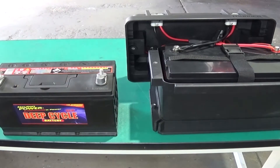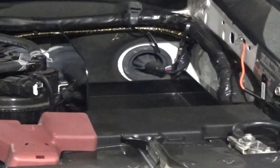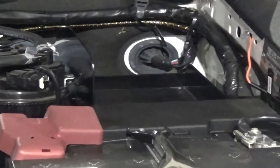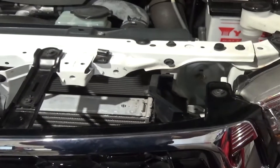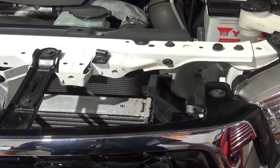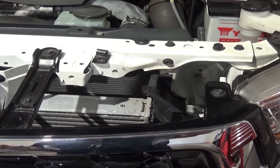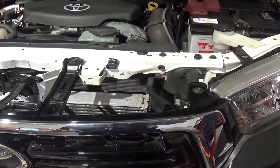So there you have it, that's the battery to choose. Usually with the Hilux, the dual battery — there's room for it in the back corner behind the passenger side. Normally we would put isolators and that sort of thing for the dual charging system, but we're using an Intervolt DC-to-DC charger here, and the manufacturer said it was best to situate it out near the radiator where there was plenty of cooling. So it's taken us a while to design and fit this mount, but basically we now have a beautiful mount that's going to go in this position here with beautiful airflow through this area — stay tuned, let's see how we go.